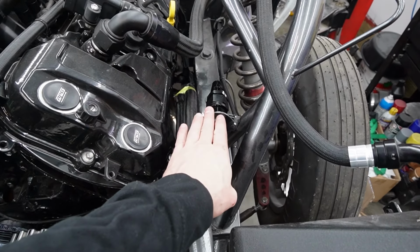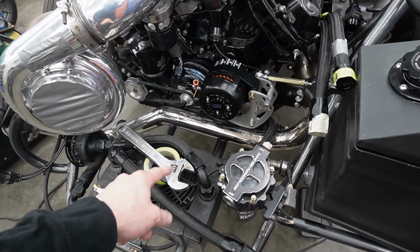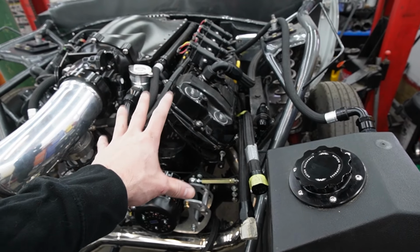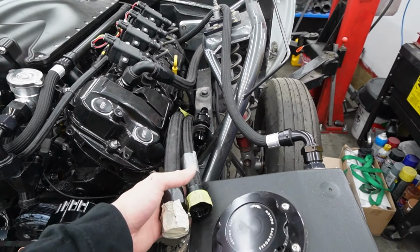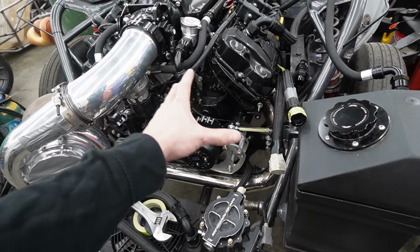And then the second part about putting the bulkheads right here is that both the engine and this small radiator in the front both join to there. So if you do want to, for whatever reason, just race this at as little weight as possible, all you're gonna have to do is loop these two lines in the back right here, get rid of these lines and get rid of the radiator in the back, and then this system by itself is just included by itself.